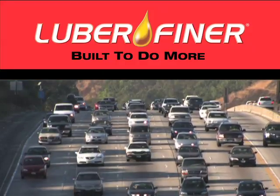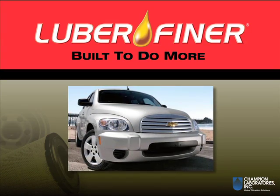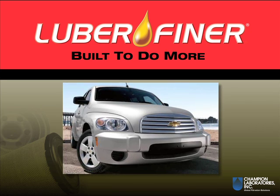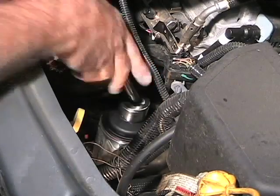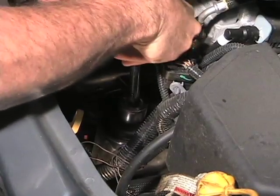For this video, we're changing the filter on a 2009 Chevrolet HHR with a 2.2-liter engine. This video will show the steps involved in changing the filter and does not include the engine oil drain or refill sequence. To begin the filter change, locate the filter housing and, if applicable, remove the drain plug from the housing cap, allowing any residual oil to drain from the housing.